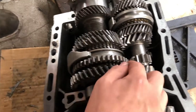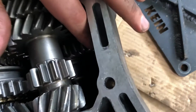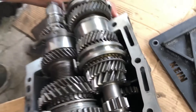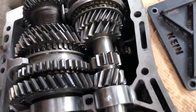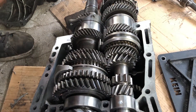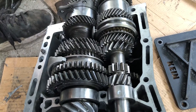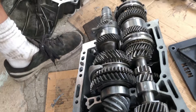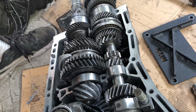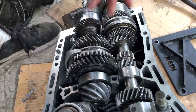These gears here are not actually meshing until you engage reverse. When I pull into reverse, these gears mesh up. We're in reverse now. It uses three gears because gears meshing together spin in opposite directions — so effectively the engine is turning in reverse as you drive around. The transmission reverses that direction back to forward for all the other gears. The reason for this is to minimize the number of gears and minimize power losses.